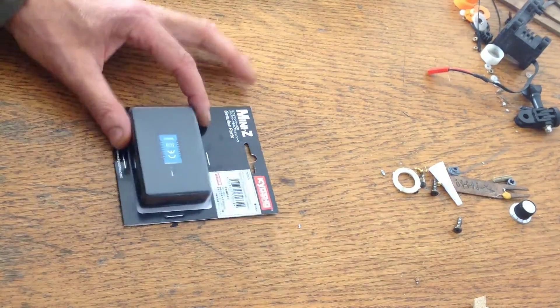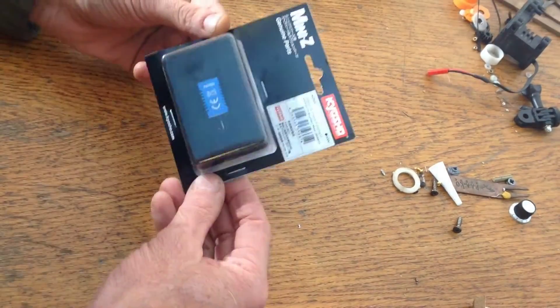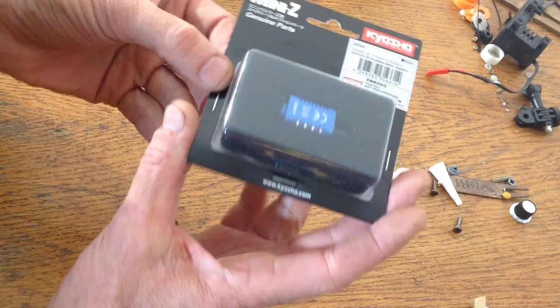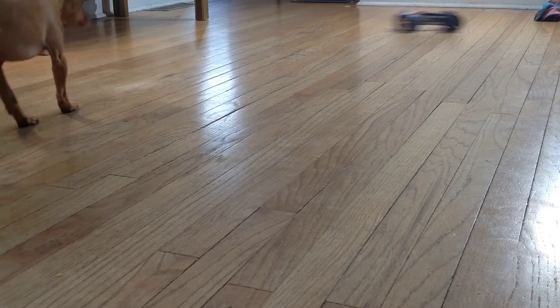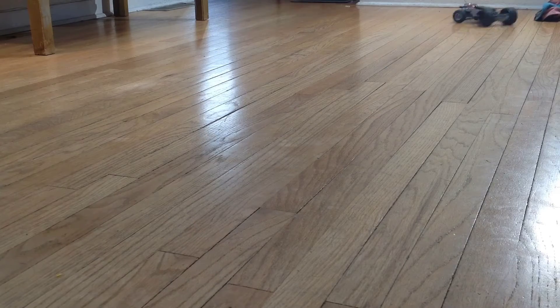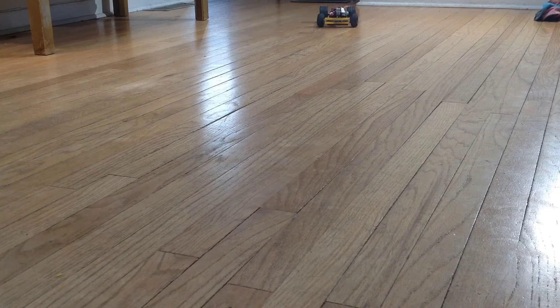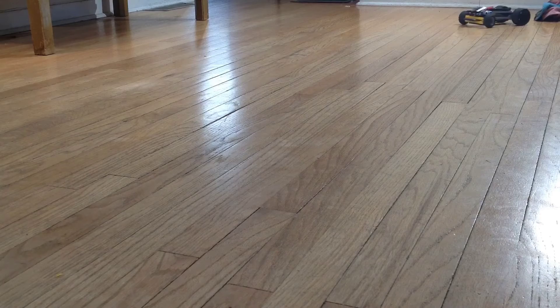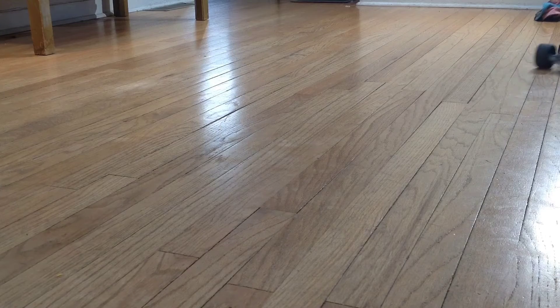If you want to check one of these things out, it's a Kyosho X-Speed 56 brushless motor — I'll have a link in the description. They come in a few different speeds. I went with the 5600KV. There's also a 4100KV and a few that are a bit faster. The 5600KV seems to work pretty well, but it would be nice to have a little bit more torque, so next time I think I'll go with the 4100KV.